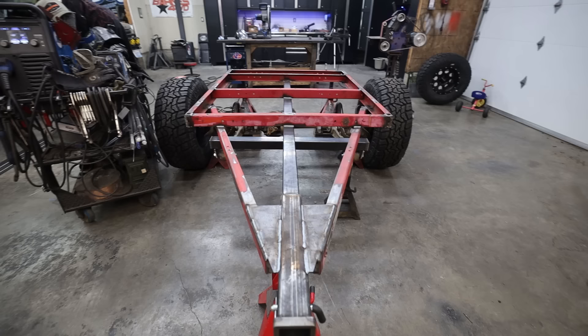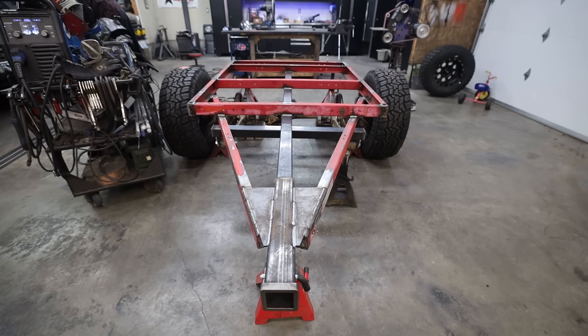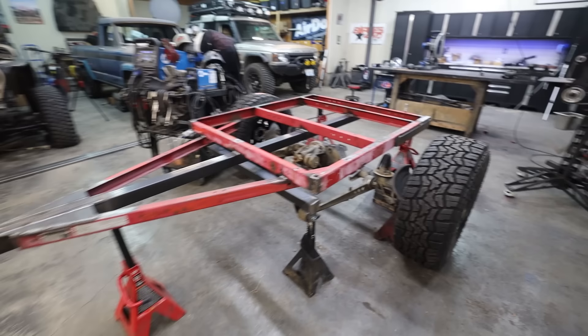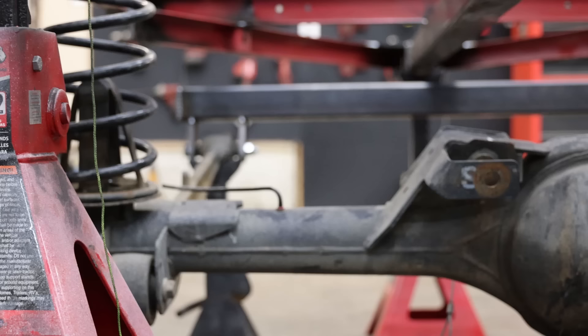As you can see, our little budget trailer is coming together. We've got a new mounting point — this goes from nose to tail — and it makes it so that if we're pulling someone out, it's a nice sturdy connection front to back without putting any extra undue stress on the frame. Just by adding this one beam down the middle made this a hundred times more rigid. I couldn't believe how flimsy this thing was when I was moving it around in the shop. We added a little bit of weight with that center beam, but we added a ton of strength, which is definitely what we want when we're building something we're going to take off-road.